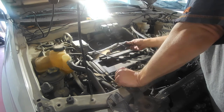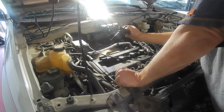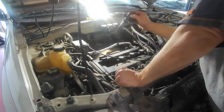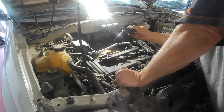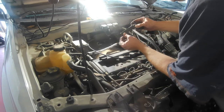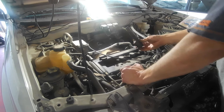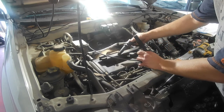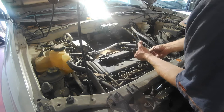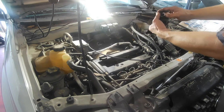Now you want to inspect these COPs. I suspected we had a leaky one — and my suspicion is confirmed. That is bad; you don't want that to happen. I may hit up NAPA — I might have a boot for this already. Generally when this happens, your boot starts to crack, get bad, and swell up. One could have bled from the other cylinder. It also has oil in it. That one does not.